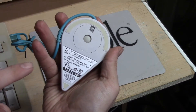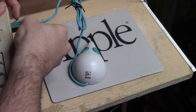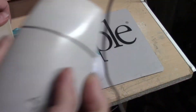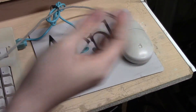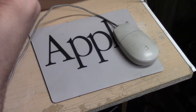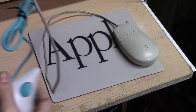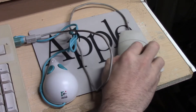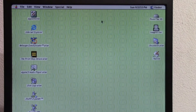The age recommendation is three and up. Let's undo the pass-through cap so we can plug in another mouse. You may think, why not just unplug the kid's mouse? Well, you're not really supposed to hot-swap ADB devices — it's not like USB. So the pass-through connector is really handy because it lets you have both mice plugged in at the same time. Both mice work as advertised; you just don't want to move the other mouse while you're using the other, but that shouldn't be much of a problem.